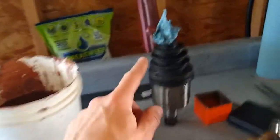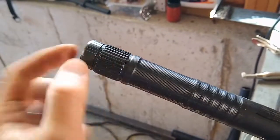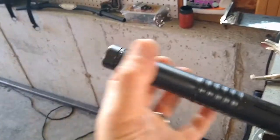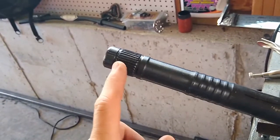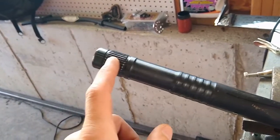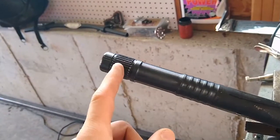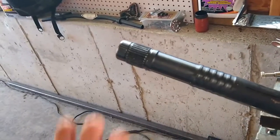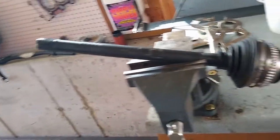To do that I've got the inner tripod joint all disassembled — it just comes off. It's got a snap ring and the tripod slides over here as retained by the snap ring, so once you take the boot off you just slide the whole thing off, get the snap ring, and it all comes off. These splines were pretty loose so it didn't even need to be hammered. Factory axles I've dealt with before have been tight enough that you had to whack them with a hammer a few times. I'm not sure if that's good or bad that the splines are a little loose on this aftermarket axle.